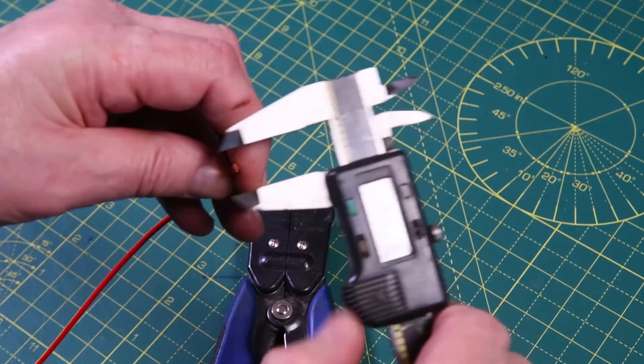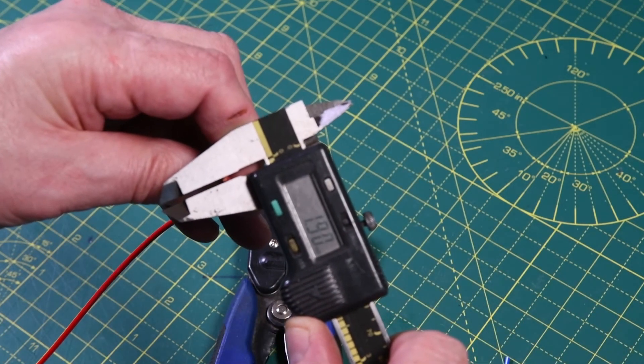The vast majority of bikes made in the last 50 years will have 12V electrics, and nearly all the wiring on the bikes will be fine with 1mm wire. The wiring from the alternator to the regulator rectifier and onto the battery and the fuses often uses 2mm, and the main feed to and from the ignition switch generally uses 2mm.